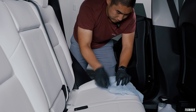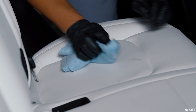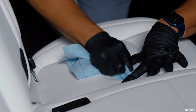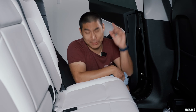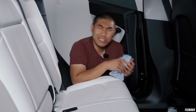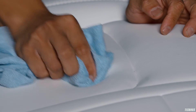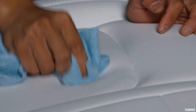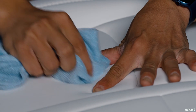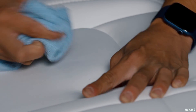After the third round on the permanent marker, it's definitely a lot lighter but still there just a little bit. Our interior cleaner isn't quite strong enough for the Sharpie, so now I'm switching to 70% isopropyl rubbing alcohol. I'm going to rub that and see if I can make any progress. I feel like I'm making a little bit of progress.